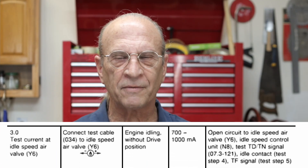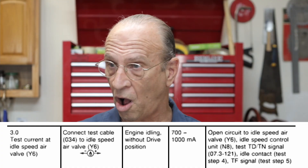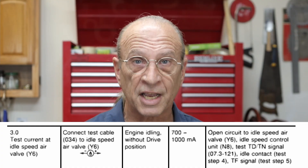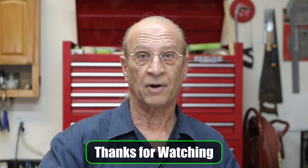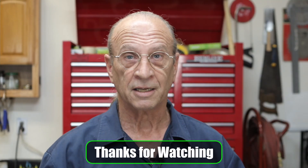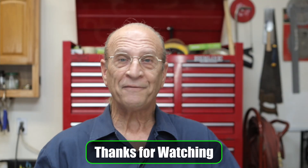All you have to do is measure that — if you're reading between 700 milliamps and one amp, you're good to go. All the elements have now been tested. If you go to the beginning of this playlist, everything we've touched on right now has been tested. So you can do duty cycle. Otherwise, wait for me.